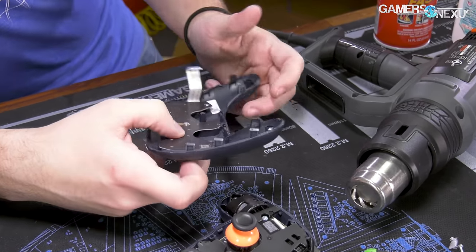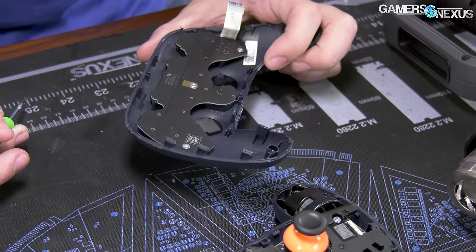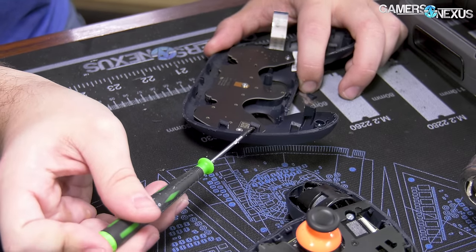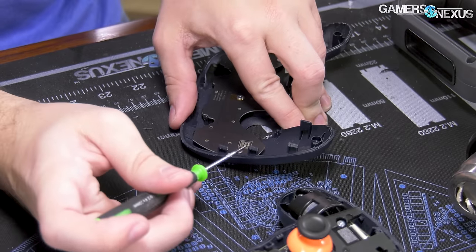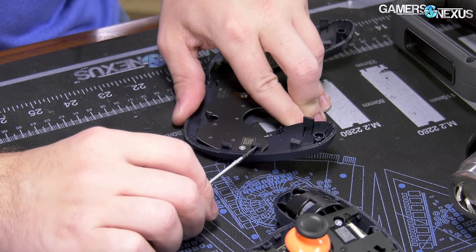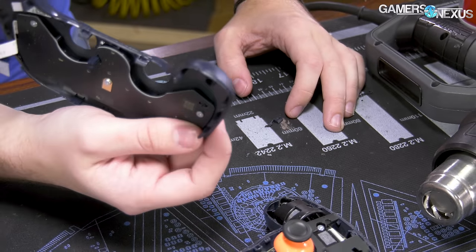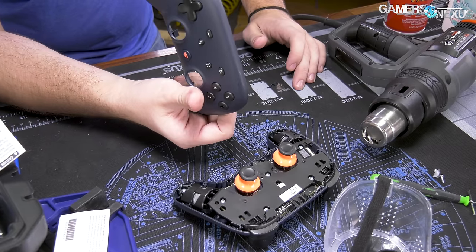The clips are massive. Unlike better laptops, you can't really get a small flathead in here to reach the clip. Ideally you'd pry a little, look in, find where the clips are, and then go in with a flathead to depress the clip. But even when it's exposed, I can barely move the thing with full leverage. I don't know if there's a better way, but I'm not convinced there is. I don't feel bad about cutting it open because it was just getting ridiculous.